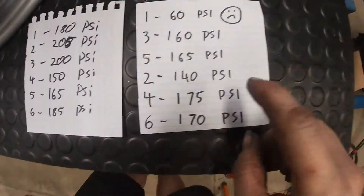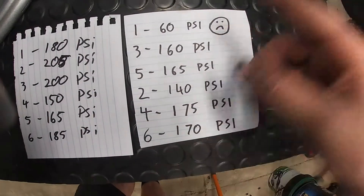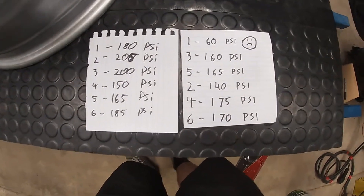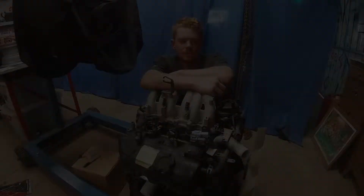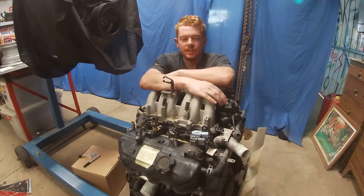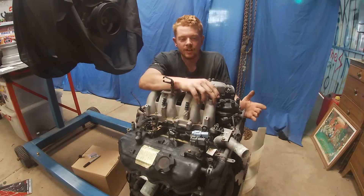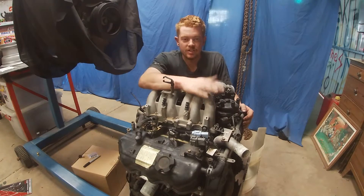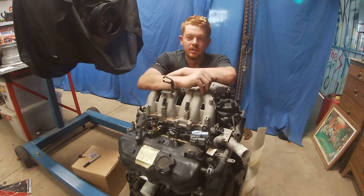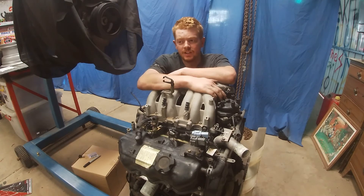So if we compare the old motor to the new one, the lowest on this one is still ballpark in there — some are a little bit higher but they're all healthy, so I've got no issues with this motor. I'll just tidy up a few things and drop it straight in. That's about it for this episode — this motor is good, got decent compression, so I can put it straight in. I just have to get the snapped exhaust studs out, take the front cover off to check the timing belt, and besides that it's pretty much ready to drop in. I just have to save up for a clutch — I'm getting a nice Exedy button clutch because the clutch in it is starting to slip under boost. So I'll save up for that, tidy this thing up, then swap it all over. Thanks for watching, I'll see you next time.